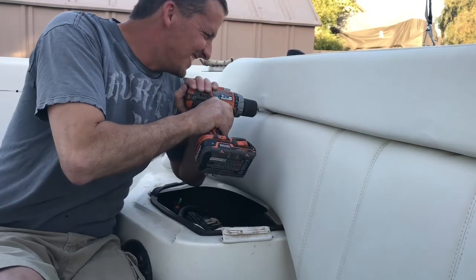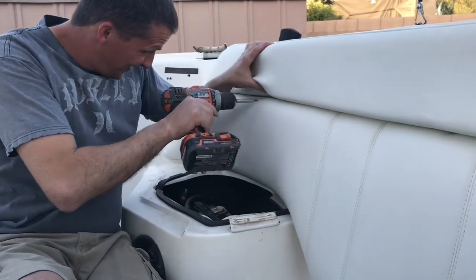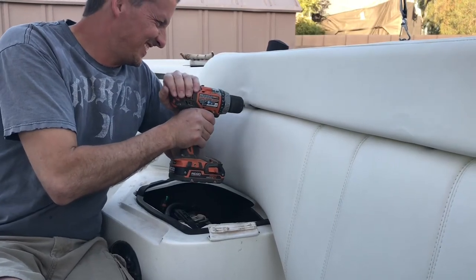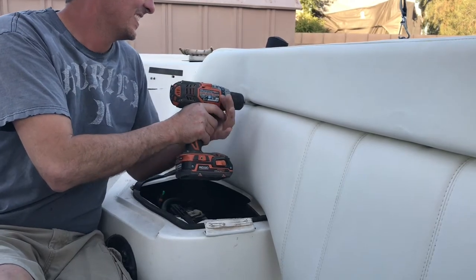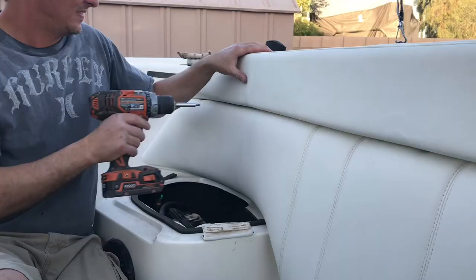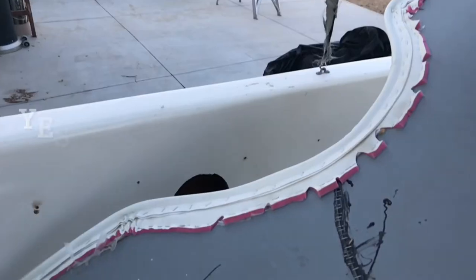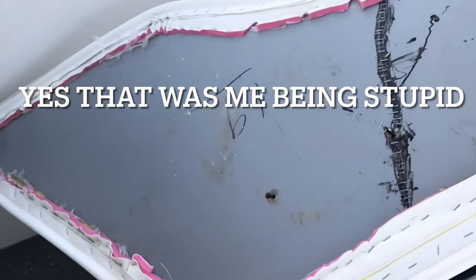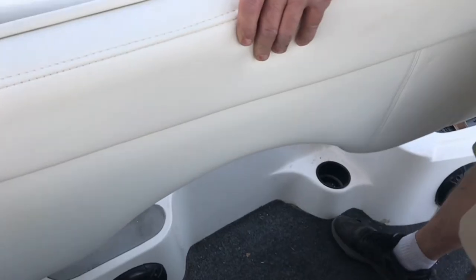What I ended up having to do is cut some of the upholstery back — which didn't really matter because I was getting it re-upholstered anyway — making sure not to damage the foam or anything else on the panel. Once I peeled back the upholstery, I was able to take a pair of pliers and either snap off the head of the screw so I could pull the panel off, or unscrew it with the pliers on the head. If I snapped off the head, once I pulled the panel off, I would use the pliers to unthread the rest of the screw out of the boat. I also ended up snapping some plastic by tugging on a panel, so cutting and using pliers is the better approach.